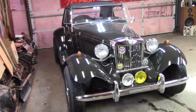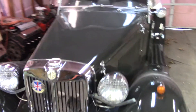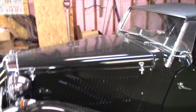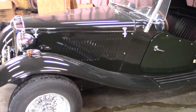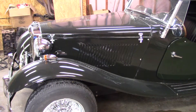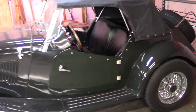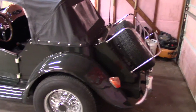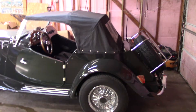He started building it. As I said in the other video, it has a 2.3 Ford four-cylinder motor — the head was shaved 60 thousandths, it's got ten and a quarter to one compression, maybe three-quarters; I'd have to look to see what the Ford Pinto motor originally was. It's got a header on it. It has a four-speed manual — dad doesn't believe in anything having an automatic if it's a sports car. He's got a Z3 BMW with a five-speed.